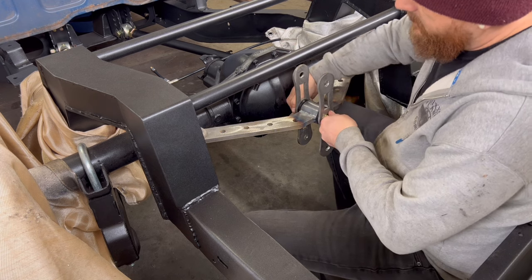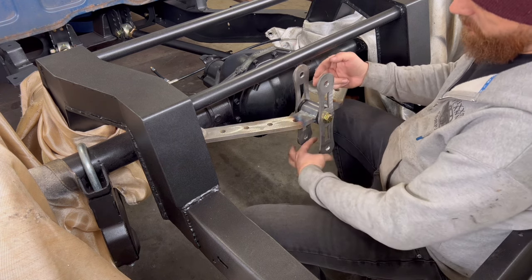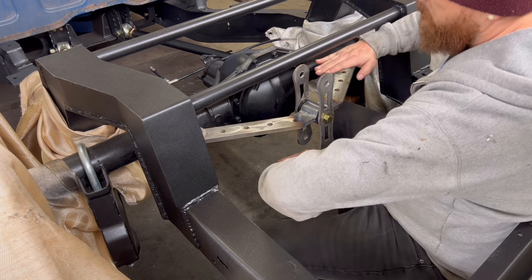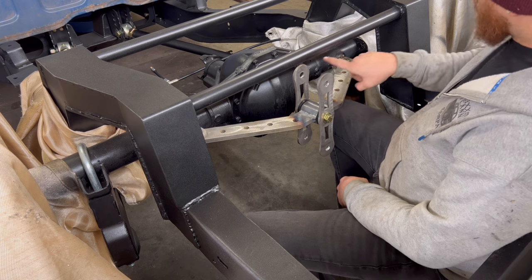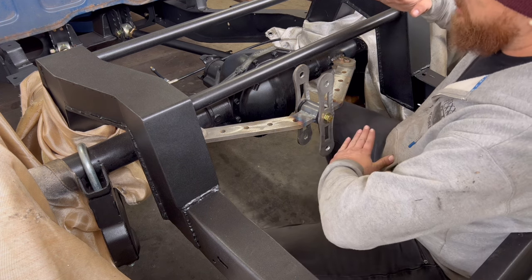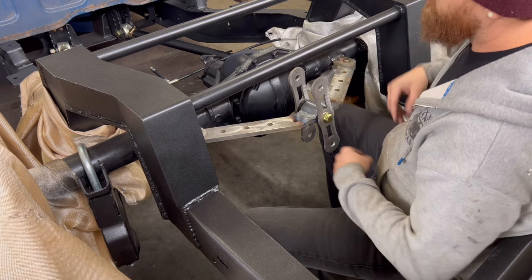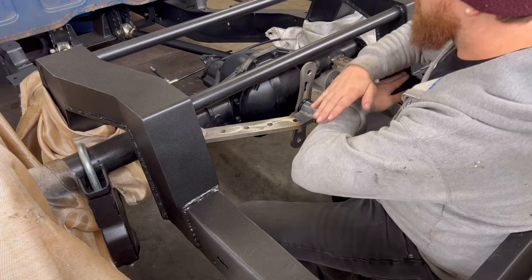I've got this hand-tied in here to give you an idea — those bars are going to connect to the middle, those spacers will go in between, one link bar will go over here and mount in, and the other will go below the frame and mount in. When you go up it moves the bars up, when you go down it moves them down. At ride height I want those bars level straight across on the top and on the bottom. When you go down the bars will be uneven, then when you hit ride height they'll be even. A watts link works by: if going up pulls the panhard bar one way, it pushes the other side the opposite way.